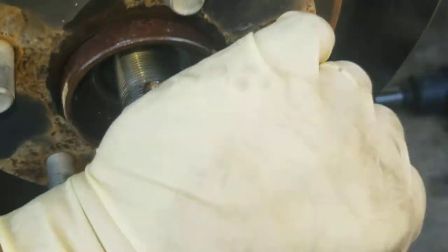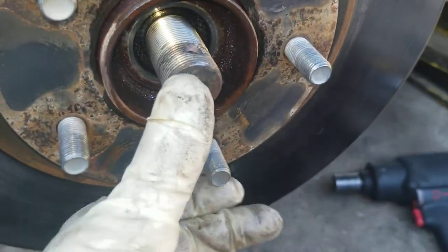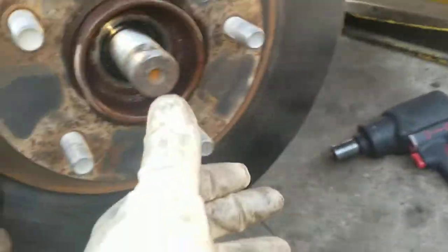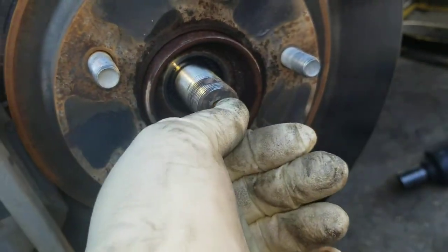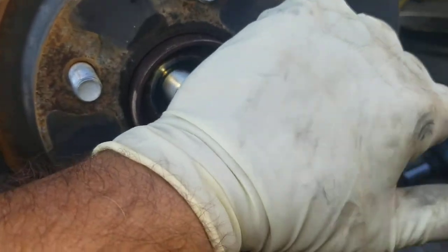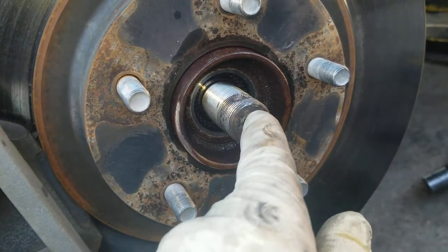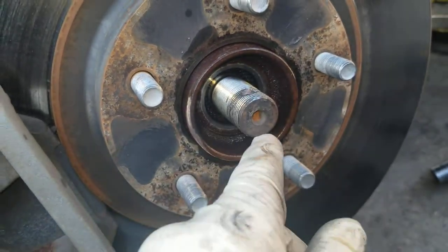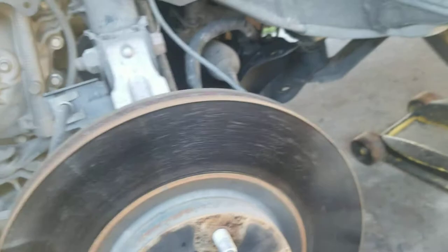So far this is looking like a fairly reasonable deal for most people, until you have to take the axle loose. Sometimes these axles will be stuck really bad. I shot WD-40 in there and got my impact chisel wrench out to drive it in a little bit to get it loose. It came loose very easy — this is Texas, so we're not in bad shape here. Just don't hit this with a hammer — you've got to use something right in the center to drive this in and not mushroom it, because as soon as you mushroom this, you're going to have lots of problems.